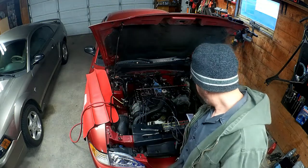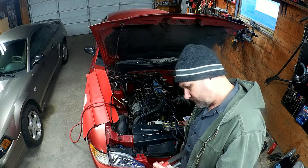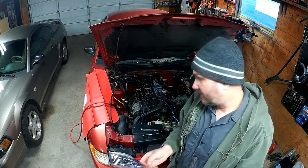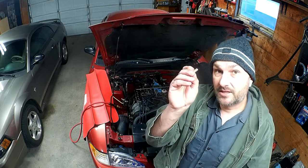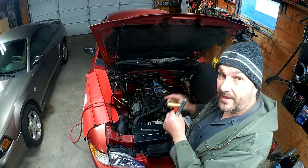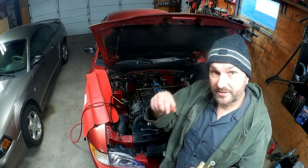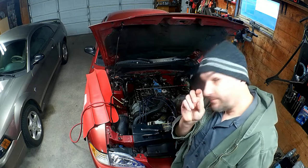Assembly grease, the new valve stem seal. Sometimes there's a different one for the exhaust ports versus the intake ports. In this case, they're all the same. This little guy here, the job of this is to protect the seal from the sharp edges of the top of the valve where those little retainers live. So this guy here is important.